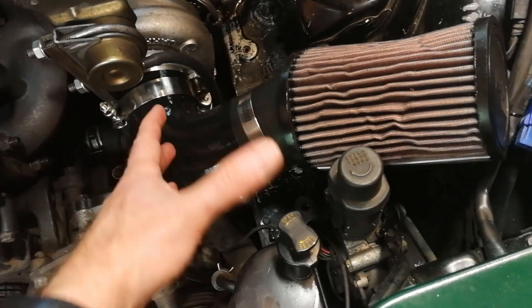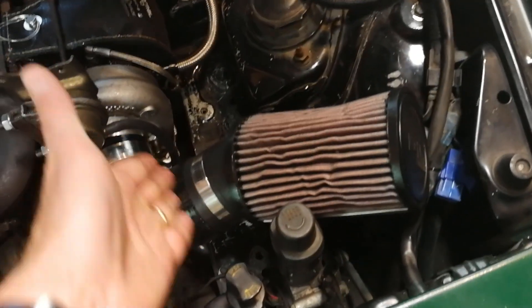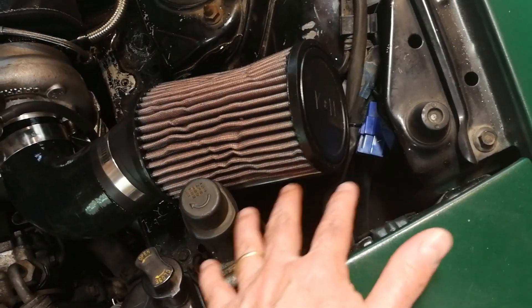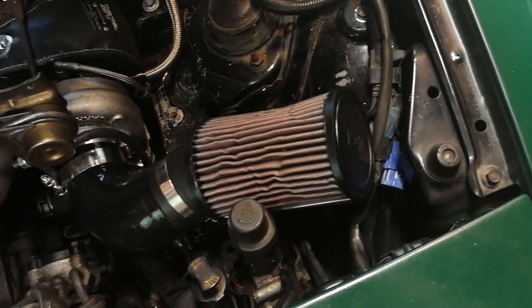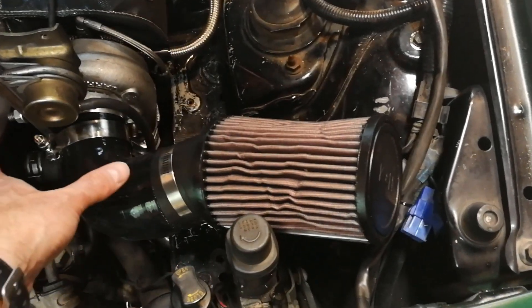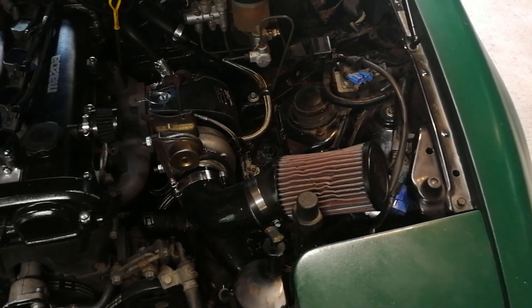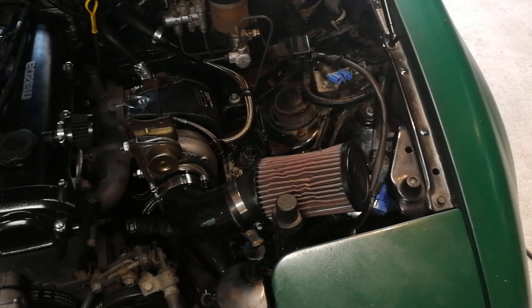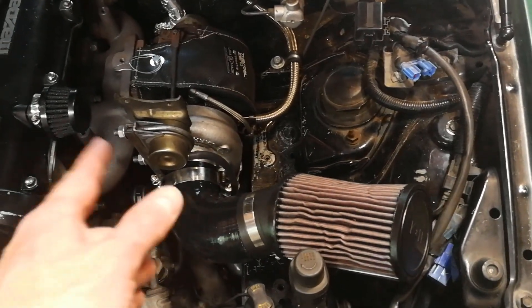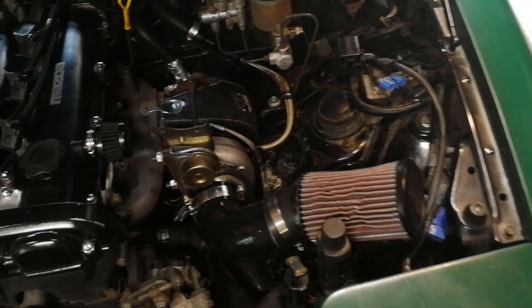What this bend does is put the filter a little bit out of the way. Instead of sitting right in front of the radiator fan, I moved it off to the side so I can build a shield around it, keeping the cooler air — which comes in from that area — going right to the filter. It's not a cold air intake, but it's definitely better than a hot air intake. Your intercooler is only going to do so much; no reason to add extra heat on top of that.